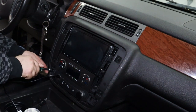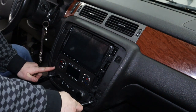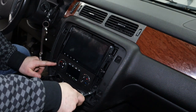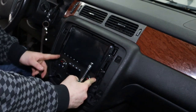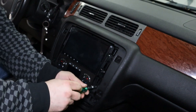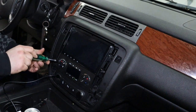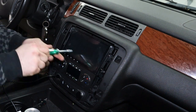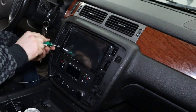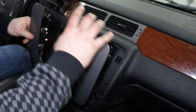What works best when putting these GM dashes back together is to start from the bottom — the panel that stacks furthest out — and work your way up. You'll feel them pop into place, which guides everything back together nicely. Then work your way up tightening them down snug. Double check that all screws are tight so you don't have any dash rattles, then grab your bezel.